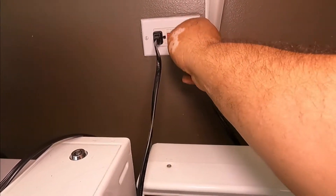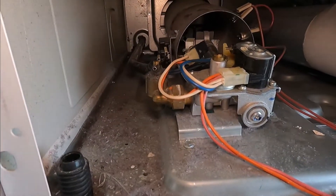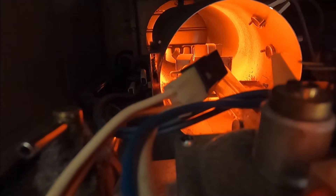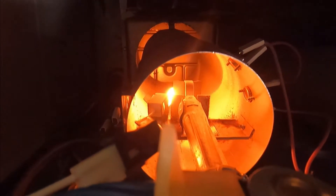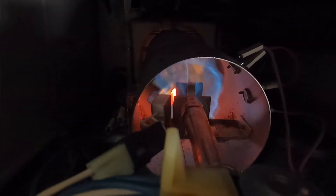We're going to plug it in to test it. Turn it on at the switch — if you hear the click, good. I'm going to turn the lights off so you can see the igniter. There you go — the igniter is getting red hot. Now it's allowing power through, and the igniter sensor on the left is going to recognize that and send the signal to the coils. There we go — we have flame! Houston, we have flame. The dryer has been fixed.